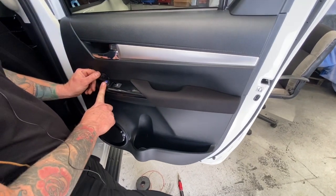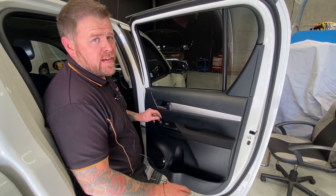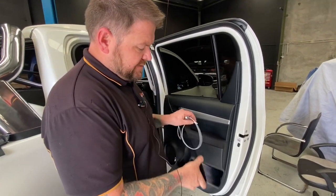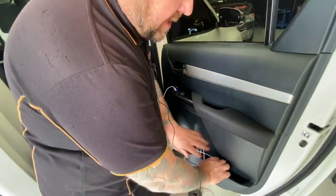Now, this is powered up all the time and it pulls 20 milliamps. So generally, depending on what car and battery you have, you should theoretically have 30 to 45 days of this being powered up with nothing charging — just a blue LED and no running of the vehicle — before your battery goes flat. If you're driving the car every day, you won't even notice it. So we're pretty much done here. We'll plug in Tim's phone — the flap is removable, you don't need to run it if you don't want to, it just covers up that blue light. Plug in the charger and it's already charging. You can simply tuck your phone or iPad inside the door trim and it's out of the way. That's it from us today. You can charge your GoPros, cameras, phones, iPads — there are an extra four power points in the back to charge from. Make sure you hit the like, hit subscribe, share this around, and we'll see you in the next one.